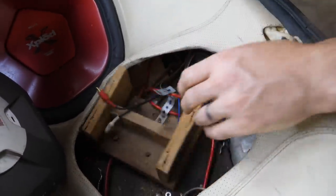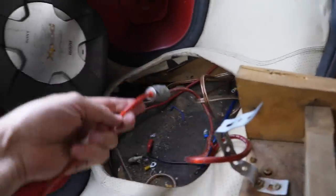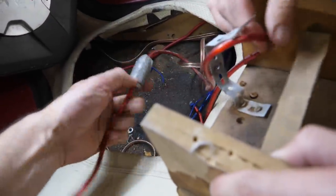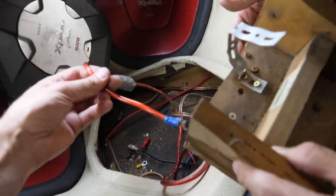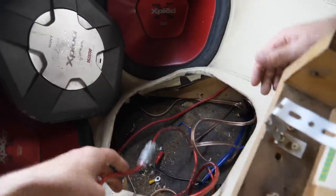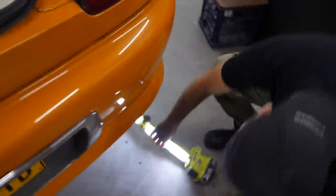Yeah, and you know what this is telling us as well? There we go. That sort of is a little bit of a giveaway, is that the fuse holder, unless that's been put in incorrectly, well, actually, the fuse is supposed to go as close to the battery as you can get it, but that appears to be near the back. But that's because of this down here, Marty. We've got a big earth wire, which is good. See, that's because of this.